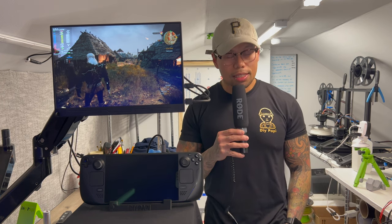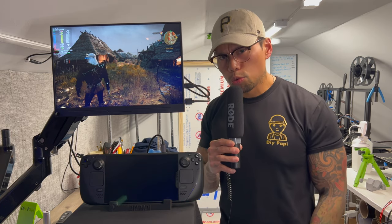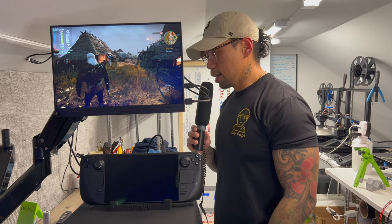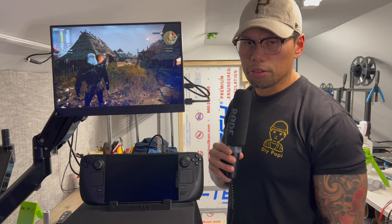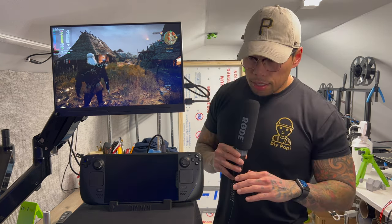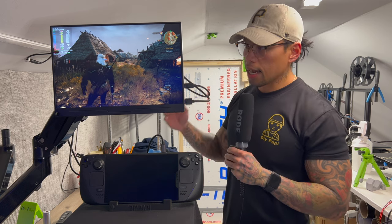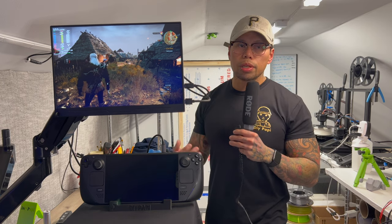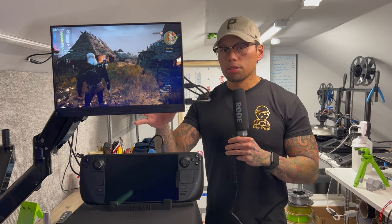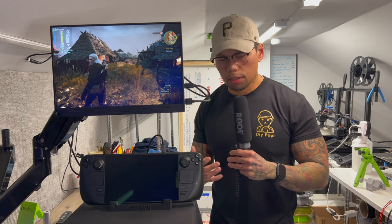The big takeaway: the best mod you can do for your Steam Deck is our original mod with the thermal pads. If you want more performance, do the compromise mod here — because you can dock it with an intake fan, giving you a minus four degrees better overall system temperature. At max RPMs, with the 4500 RPM fan, we're going to test this in a later video with a 5000-6000 RPM 40x40x20mm Noctua fan and see if it makes any real difference. I doubt more than a degree or two, but it's coming in the mail so we have to test it.